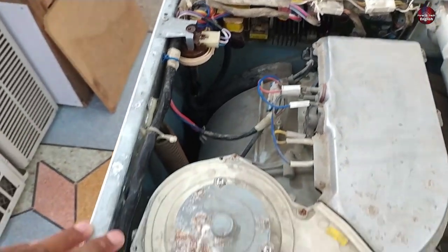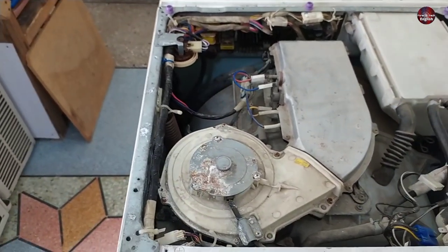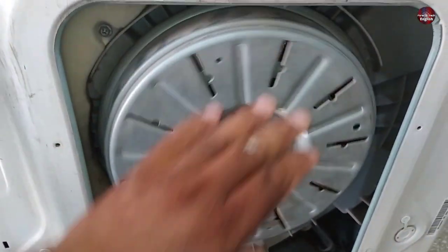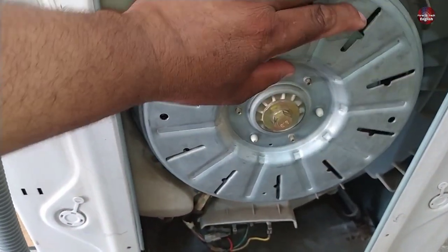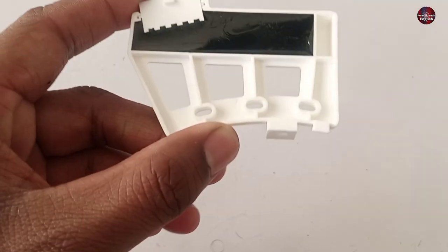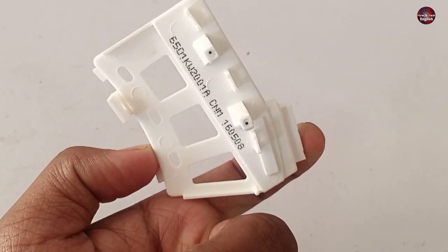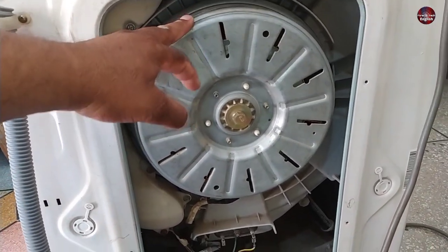Also, if the wire is burned out or disconnected, as it is extended across the washer, it can cause this error. Other than this, if the motor, the bearings, or any other component is jammed, it will cause this problem. But as I am rotating this motor, there is no such fault. A hall sensor is installed inside this motor, so if the hall sensor is bad or its wire gets disconnected, the problem will still be shown. I will open this motor to check whether the motor is faulty or the control board.